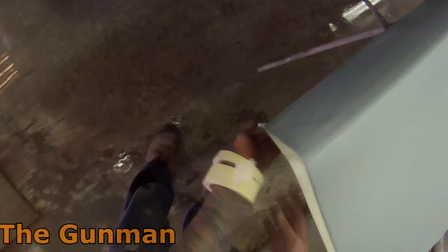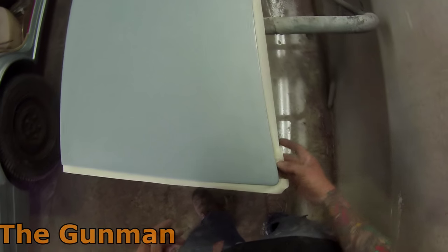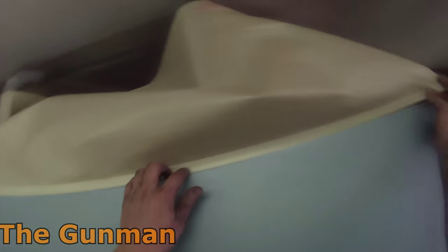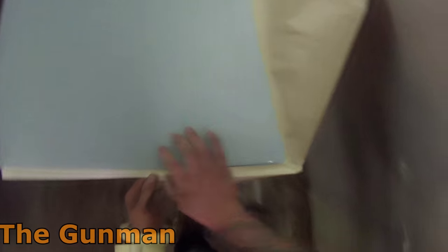I had a guy comment on the previous video I made on how to flow coat, where I did my bonnet. He said, why did you finish it off so fine? You could have probably used 400 grit. 400 grit would greatly increase the chance of cutting through, because it is quite coarse, and I would imagine you would also get a bit of shrinking back into the sanding scratches.